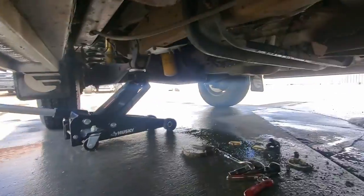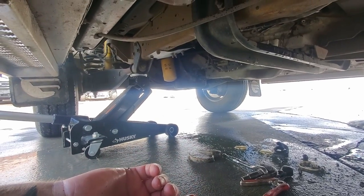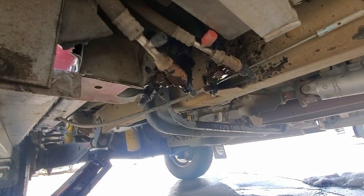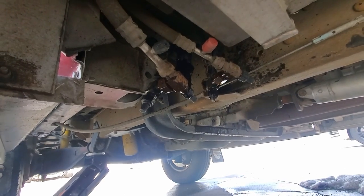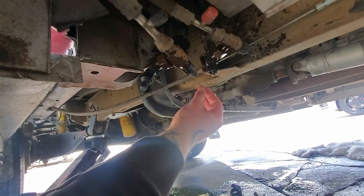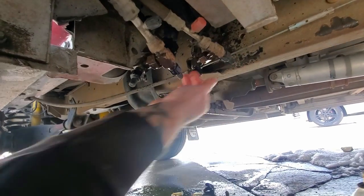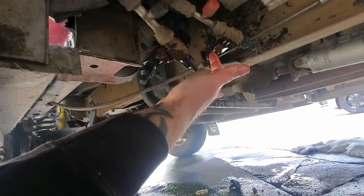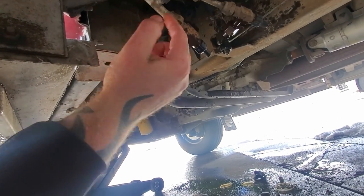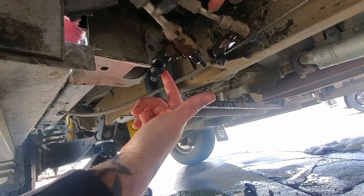Okay, so mine is a wheeled coach. It's a year 2000 E350 Econoline. My air conditioner hooks up right here. I haven't taken them off yet, but my assumption is these valves close, all four of these. So you have a feed and a return. Basically, this will shut off the one to the rear AC unit. This will shut off from the front of the car.